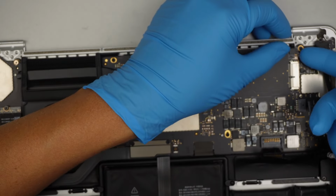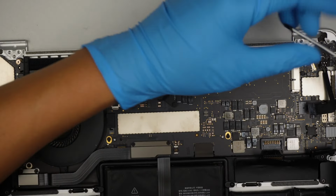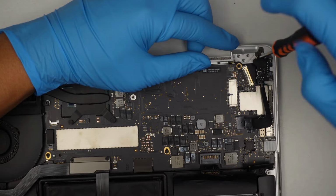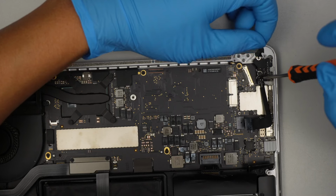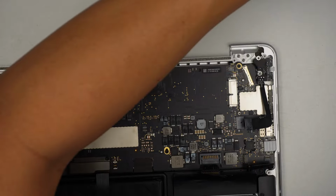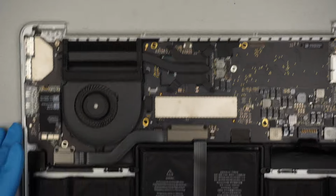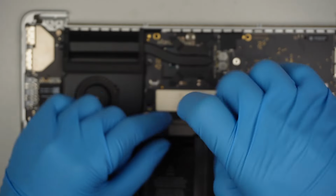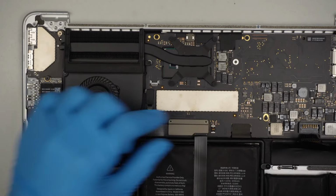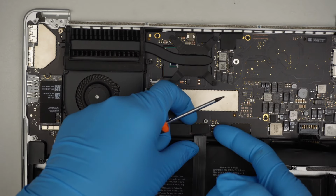Okay, at this point, I'd like to continue removing the motherboard and transfer it over. This is the DC jack power to connect to the adapter. Remove that. What I recommend is to take a picture right before all this, so that you can make yourself a reference while you're removing the stuff, especially the screws and disconnecting cables. You know where to put them back later on.